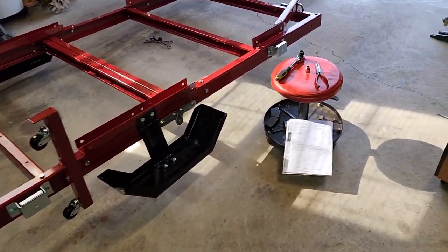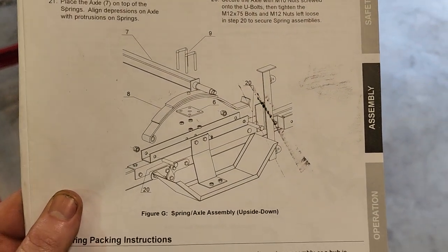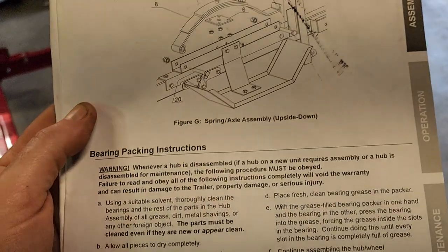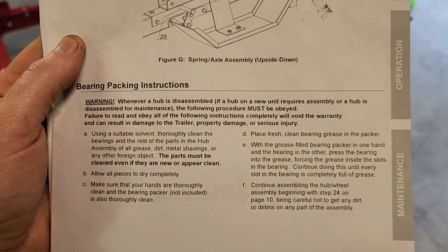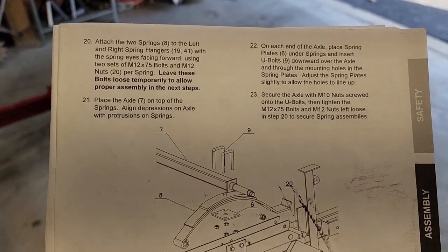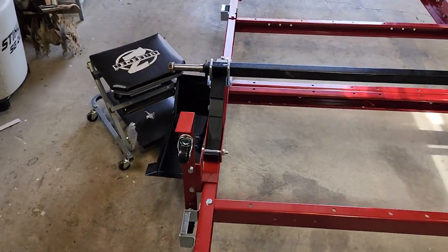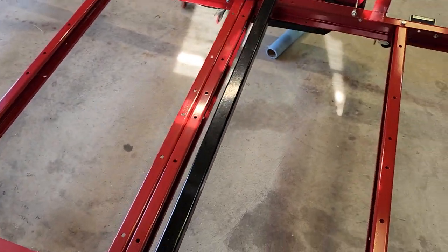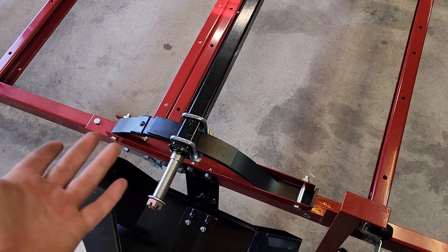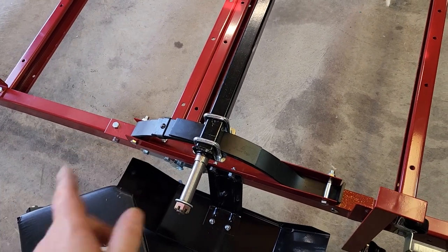It is axle time and leaf spring time. This says bearing packing - I already looked and the bearings are already packed, there's a bunch of new grease in there, so I don't have to worry about that. Got that axle zipped on there - that was super butter. There are little notches that it sits into. The only thing that sucks is tightening all four bolts on either side. I couldn't get my impact in there so I had to just use a ratcheting wrench - just another 17 mil.